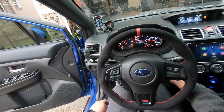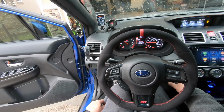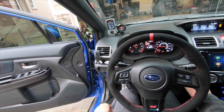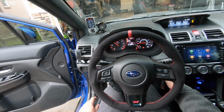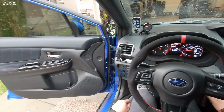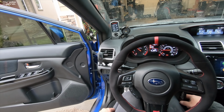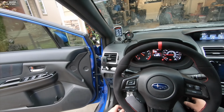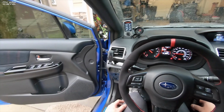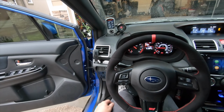It's starting like this because of the E85. And then it goes back to normal. So I'm at about E66 right now. If anything that's over, I don't know, 75, it has a hard time starting, only because, you know, it's winter time. I guess that's the reason why gas stations that sell E85 go with a winter blend, to kind of prevent that. I don't know. If you guys know, let me know down in the comments. It feels race car-ish.